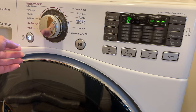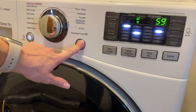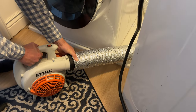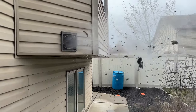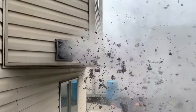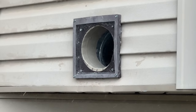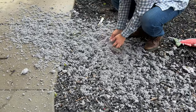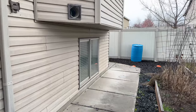After testing the dryer, I found out that we still had wet clothes, so I knew there was still a blockage somewhere. We had seen a couple of videos where people used their leaf blowers, so we decided to give that a try. We attached it to the end of the hose that goes into the dryer side. I was absolutely shocked at what came out. It would have been really smart to put something to catch all the lint at the end of the dryer vent — it was a pain to clean up, and it was a rainy day which made it even worse.